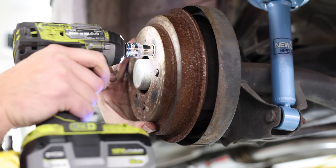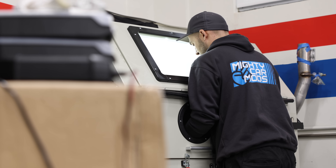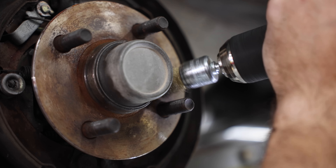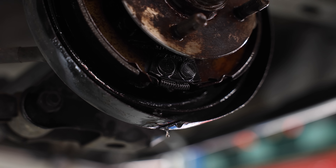Next, it's time to give the braking system some love. I'm going to remove the discs and drums, give them a tidy up and a new coat of paint. There's plenty of thickness on both the drums and the shoes, so this is part maintenance and part aesthetics. After blasting, brushing and cleaning any loose crud off the back brakes, I can remove the front discs and give the mounting faces and calipers a good clean-out with brake cleaner.